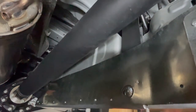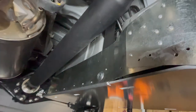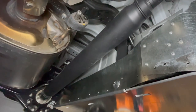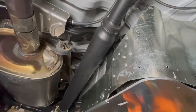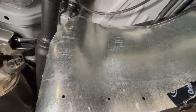I bought a sheet of aluminum from a local home improvement store and cut two pieces: one is a long straight piece that covers the interior side of the gas tank, and another piece that is a little taller to cover the front of the gas tank. The gap between the RCI off-road skid plate and the sheet I put together is actually the short surface coverage that the OEM one covers but the aftermarket one does not. I don't think this is a perfect solution — there's a lot of room for improvement — but at least I feel more comfortable driving knowing that if debris comes through, this thin sheet of aluminum will protect the gas tank.